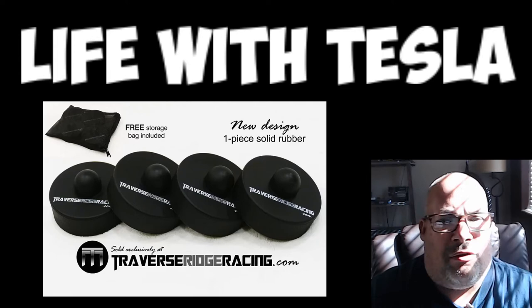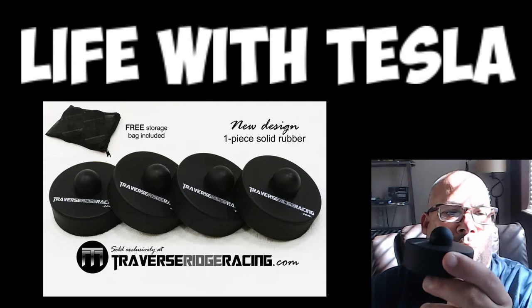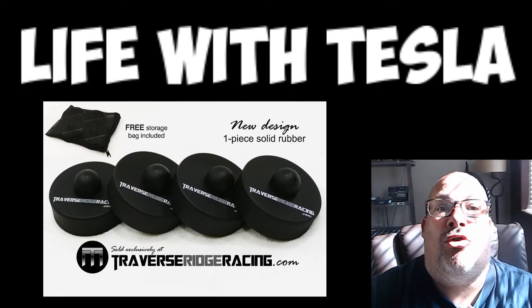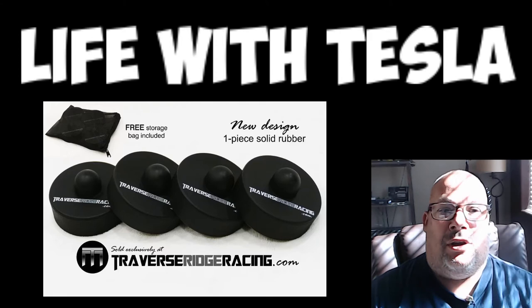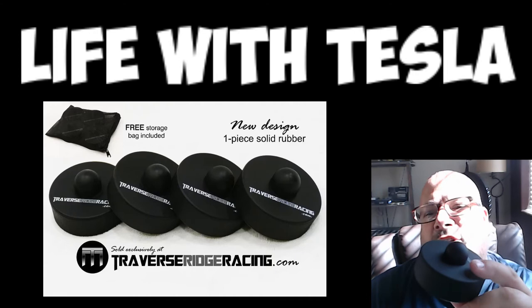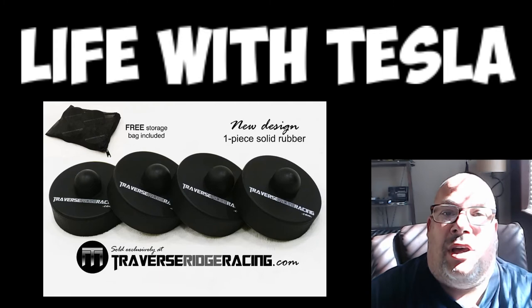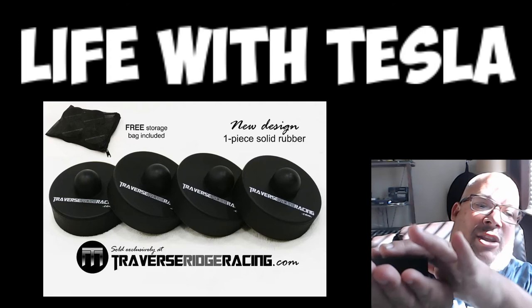The URL is right here and I'm going to leave the link there for you. My issue was I was going to tire shops because I wanted to get one of my tires inspected, and I was going around shop to shop and most shops cannot lift your Tesla on the lift, or they're going to do it improperly. You need to get your lift pucks — whatever they're called. If you have a Tesla Model 3, S, or X, it doesn't come with the Tesla. So if you've got to jack up your Tesla and do it safely, you have to have these pucks. This goes into the bottom of the Tesla, and then the jack or the lift goes there, and that's how you don't damage the battery.